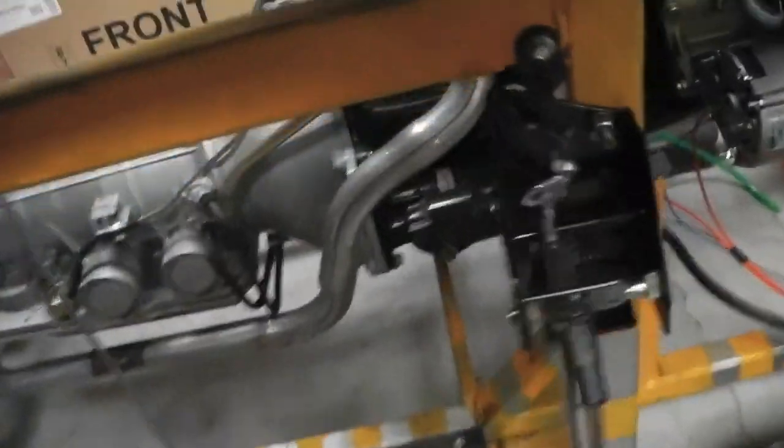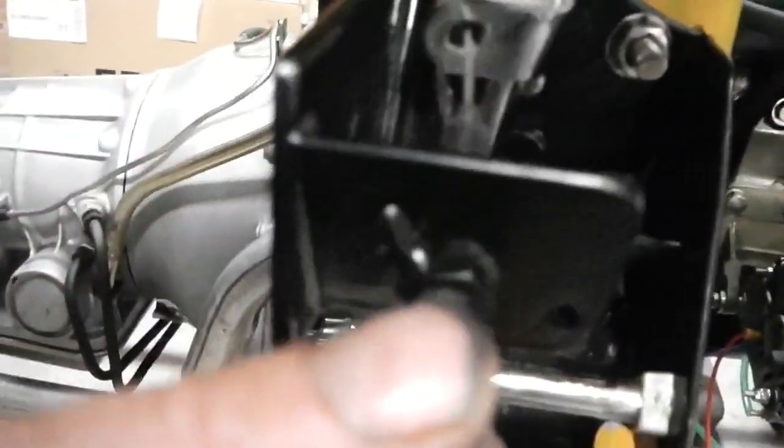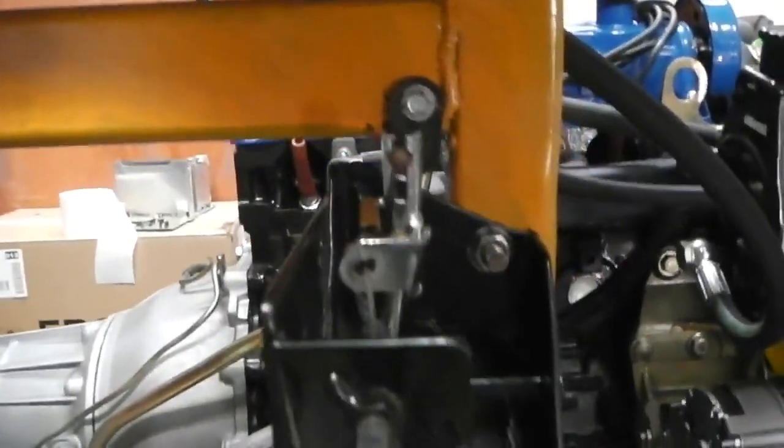So there it is. It's pretty much how we set it up on the bench that time on earlier films. The Granada cruise cable there is adjustable just to get the right bite point. You can still accelerate. We've rigged the accelerator up just on the bracket onto this frame. It's quite handy that it fitted. So I can accelerate off, and that just slides there so it doesn't get in the way of the cruise control. That's full now. But if you pull, the bellows will draw that in like that. Now, the bellows can pull 60 newton meters of force.